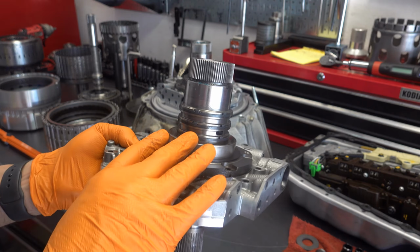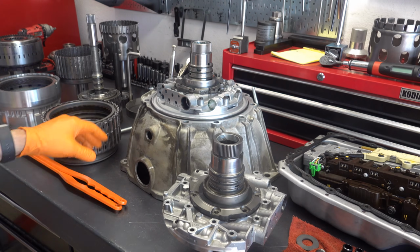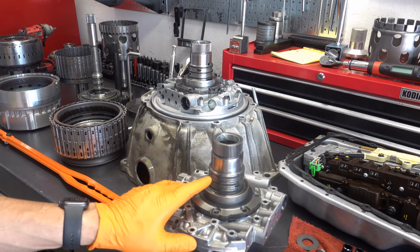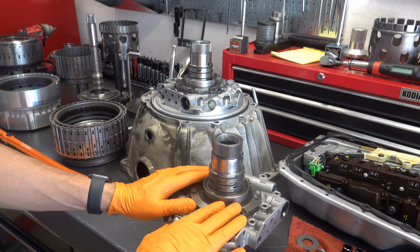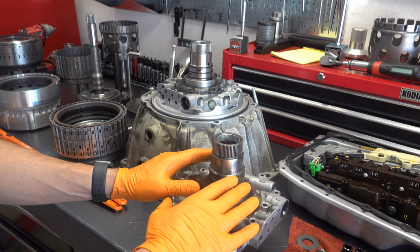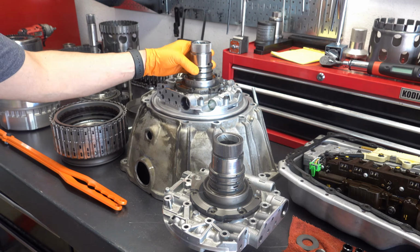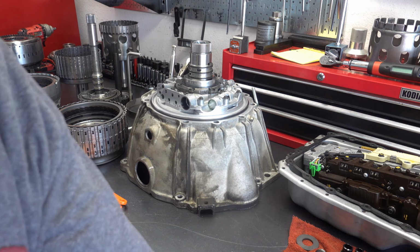What this design change did was force the sealing rings out against the sealing surfaces here in the bore of the 3.5R drum to promote better sealing integrity. Prior to this, in the earlier units using the first design stator, there were complaints and pattern issues, or instances rather, where 3.5R and 1, 2, 3, 4 clutch burnup would occur because the sealing rings were not adequately sealing, and that is again with the first design. So let's see if I could zoom in a little bit.